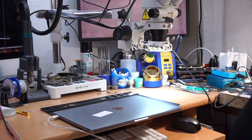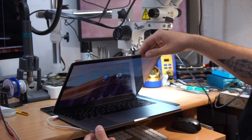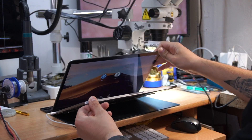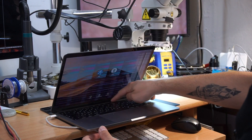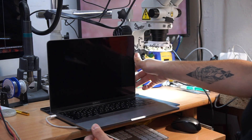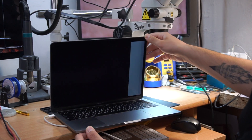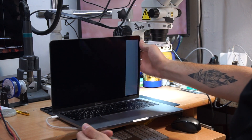Hello everyone. Here we have finally a repair that is linked to an older video on my YouTube channel, which is lines on the screen, or as you can see, a weird image on the screen. As I open and close the lid, the image comes and goes and lines appear on the screen. This became a factory issue after Apple fixed the backlight problem in the previous models. But weirdly, a couple of older models — the A1706, A1708 and so on — came in for repair with the same problem. So this issue is not for the newer models only; it affects models after 2016.